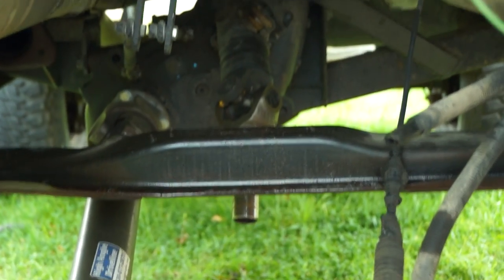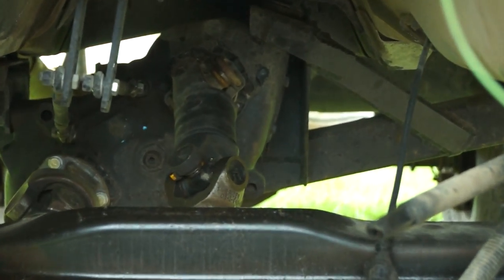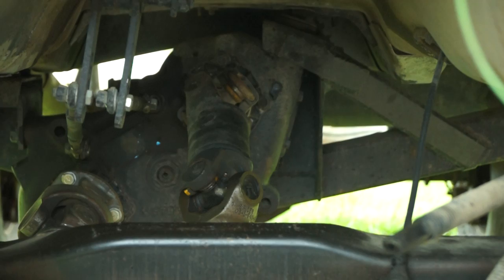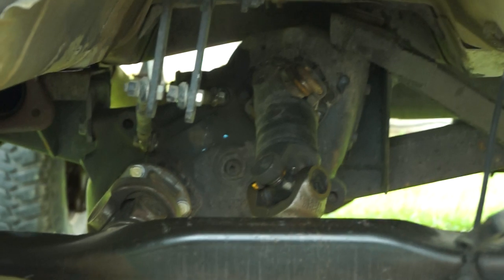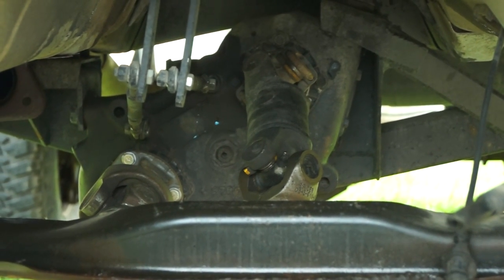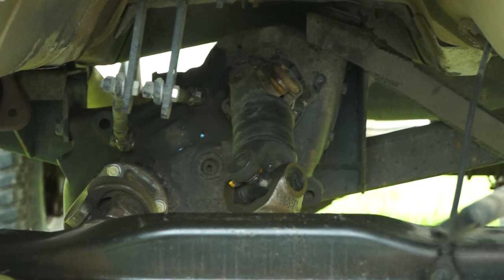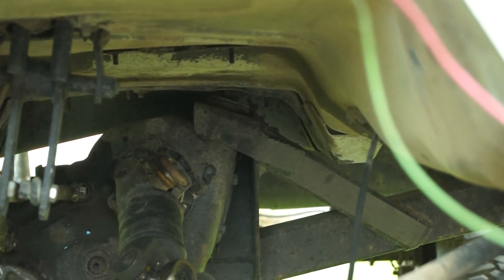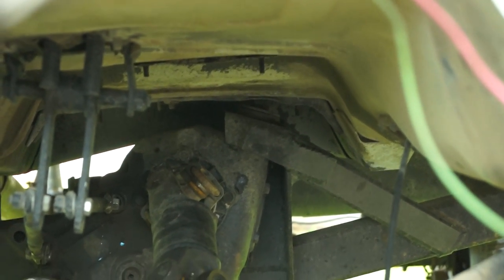When I built that, what I tried to do was mimic the way the Dodge held that transfer case in place. That's from like a 1970s Dodge or something, and when I bought it, it came with the factory crossmember. The factory crossmember just went from each frame rail and then up and over it in a big sort of half circle thing. And so I'm using the factory mounting locations on the transfer case, and what I did with that crossmember is I cut sections out of it and used those sections to hold the case, and I welded those sections onto this other stuff. So that piece right there in the center, that is the Dodge factory section. You can see the bushings there. Those are the factory Dodge bushings, the factory bolts, factory washers, whatever.